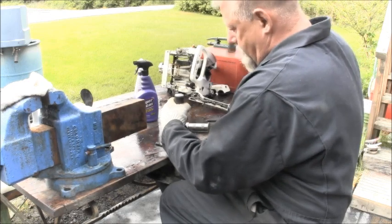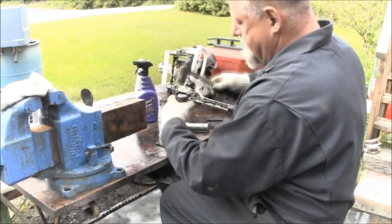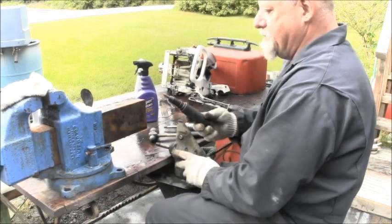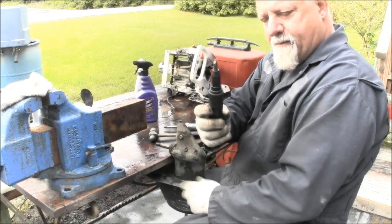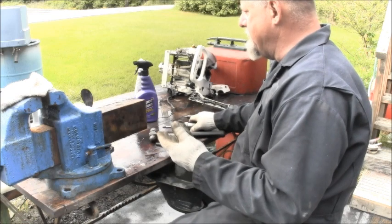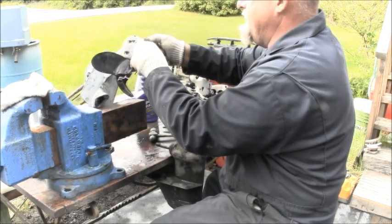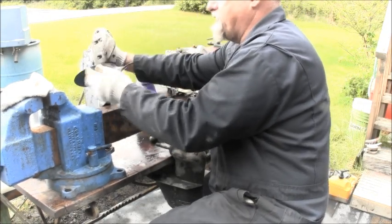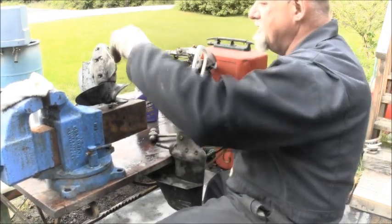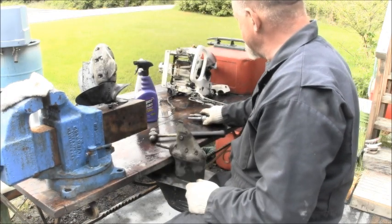These things are spring loaded, so you want to keep the turning pressure counterclockwise, and they'll come out. They'll be tight, but again, make sure your screwdriver fits and it's a real good bit. This one has Phillips screws in it, hopefully you can see that, so I needed a Phillips. Again, make sure it fits good, same process. They come in Phillips and straight.